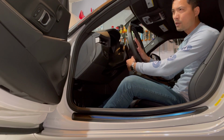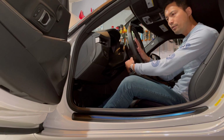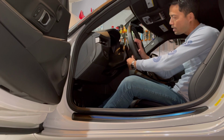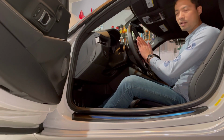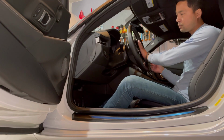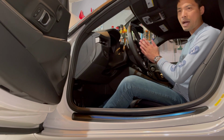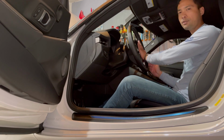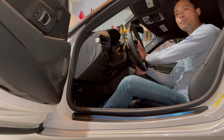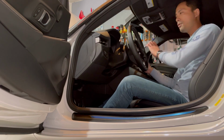You might feel a click, you might hear a click, but as you press it all the way in, you might feel a little something. With that being said, once you hold it in, you're going to pop it out. So you leave the left side out, pull out your flathead, now go to the right side and keep the right side compressed. Don't press on the center of the airbag, because if you do that, you're going to click it back in place. So compress all the way to the right and repeat the same process. You're going to feel the spring give, and that compresses it to release it, and then you pull that out.